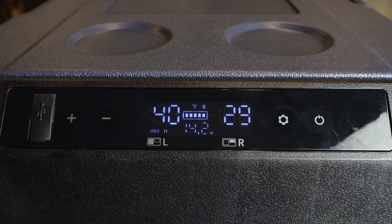If you have the fridge connected to your vehicle and check it in the morning after it's been connected all night, and you see the error code F1, that means the fridge is in battery protection mode and has shut down to protect your car battery.